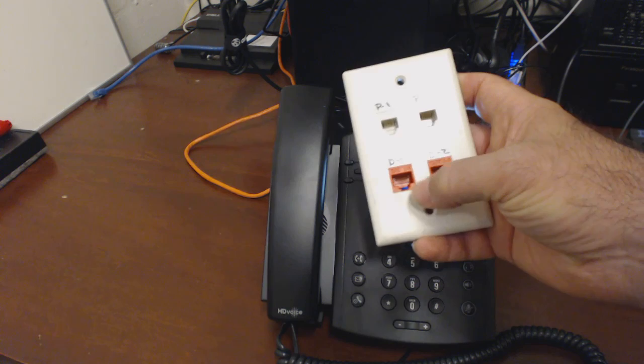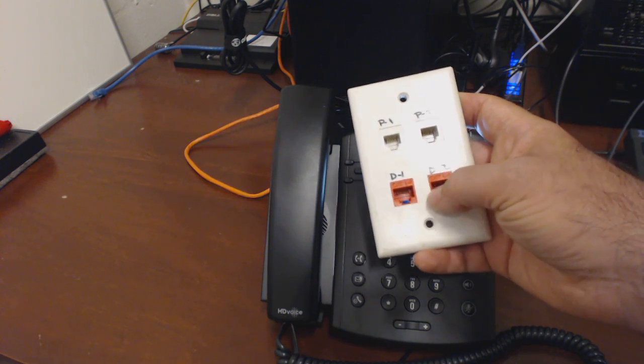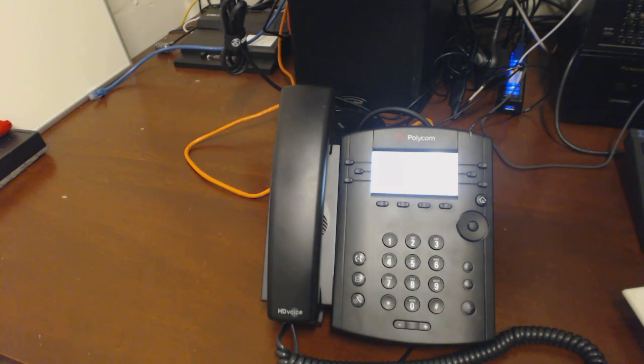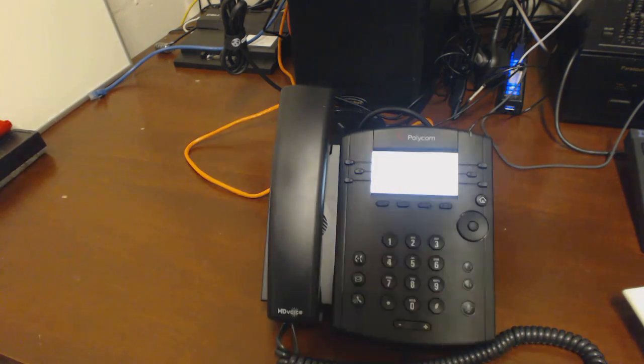So try going back to where the network plug goes into the wall and check to see if maybe it needs to be in the other outlet. Also, are you using the right cord? Don't get these things mixed up. Phone cords and network wires are not the same thing. Here, I'll show you an example.